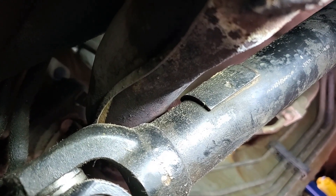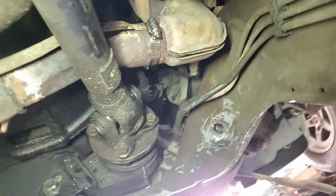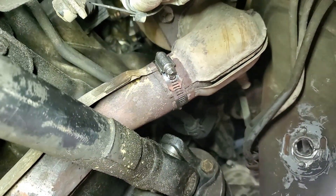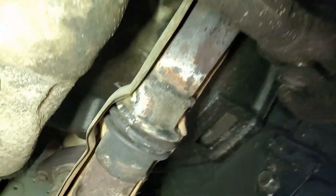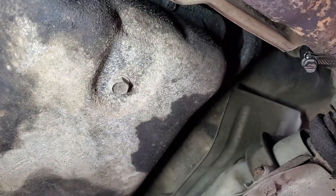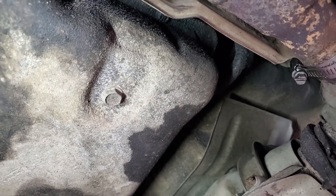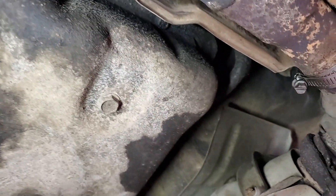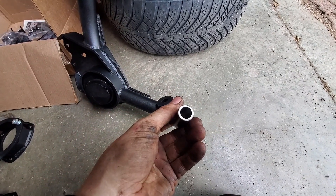Clearancing with the hammer gave me the clearance I was looking for. It's still close but there's way more gap now, so I'm not worried about it actually contacting and touching the exhaust when it's spinning. One thing I'm doing that they didn't include in the kit is keeping the top part of the heat shield and clamping it back into place. We threw the lower part away because it'll interfere with the driveshaft, but this is an automatic transmission and there's no sense putting that exhaust heat into the oil pan and overheating the oil.